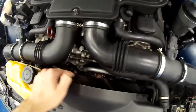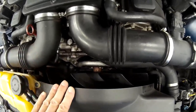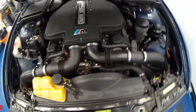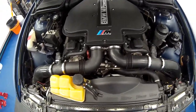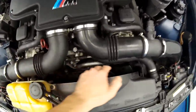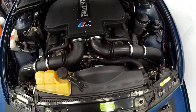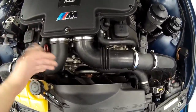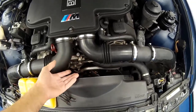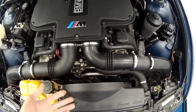This electric cooling fan will replace the standard viscous fan clutch and viscous fan unit, and will mount in the OEM fan housing. The reason behind doing it: the engine on this E39 is now hooked to 115,000 miles and it's the original fan clutch assembly. Whilst there's nothing wrong with it at the moment, it's getting towards the time where it could suffer a catastrophic failure. If that happens, generally the fan will disintegrate due to age and heat cycle fatigue, and once it starts to disintegrate a blade snaps off.